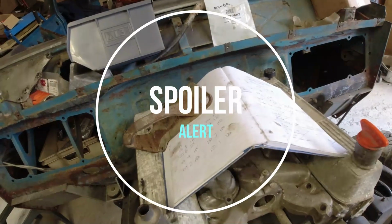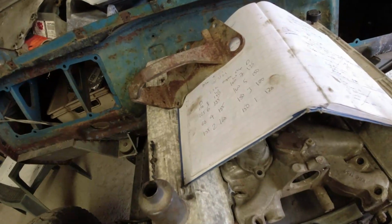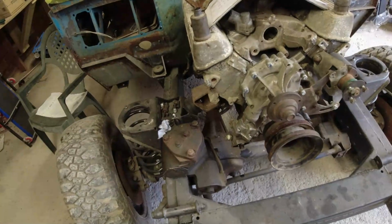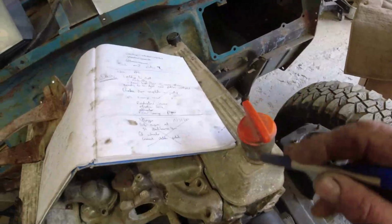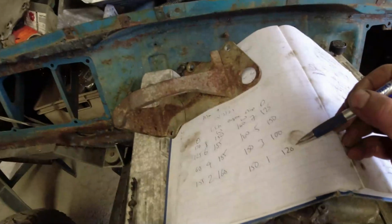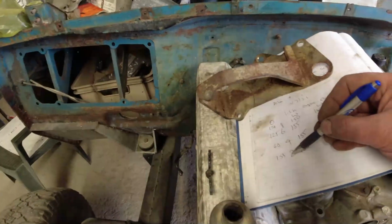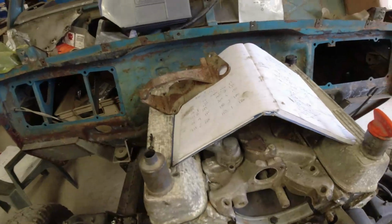For some inexplicable reason, none of it videoed, not one little bit. Anyway, I'm just going to have to talk you through what I did. So basically the compression test from 1, 3, 5, 7, 2, 4, 6, 8 came out as 120, 100, 150, 125, 155, 60, 125, 130, and I was a bit disappointed, if I'm honest.